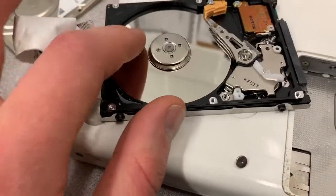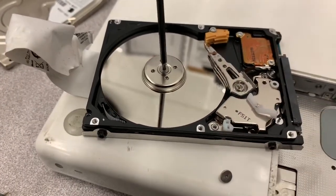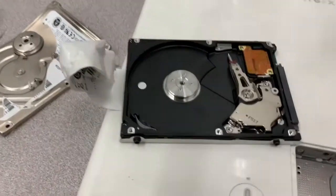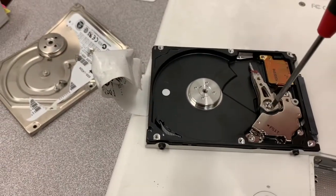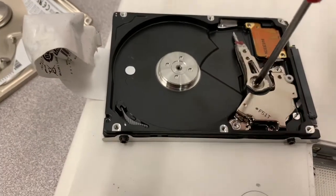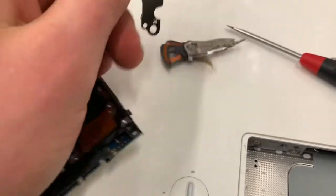I'm going to pull this disk right out — that's held in with a Torx bit. So I'll use the Torx driver to pull that disk out, then pull the magnet out, and the rest I'll just throw away. So I got the disk out — that was pretty easy once I took the Torx screw out. I removed the two Phillips screws from the magnet, but the magnet is still in there. There's actually a little nut where the little sweeping arm attaches. You put your flat blade screwdriver right where it pivots, unscrew that, and now you can get the magnet out. There we go.